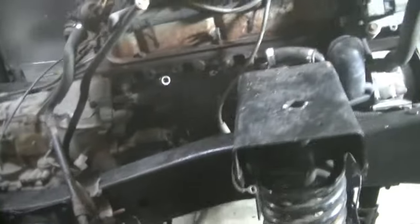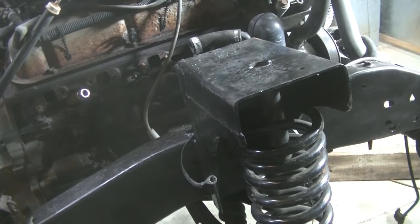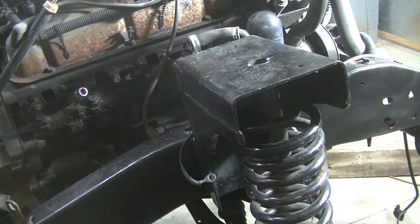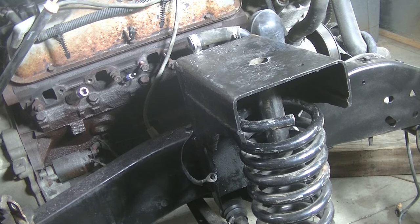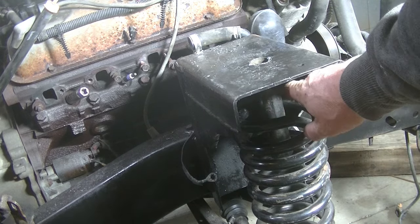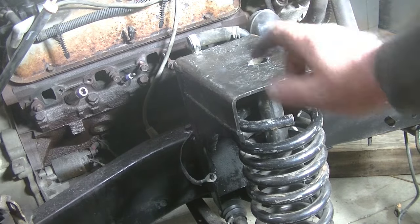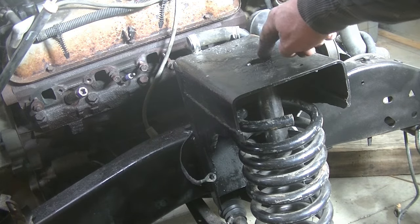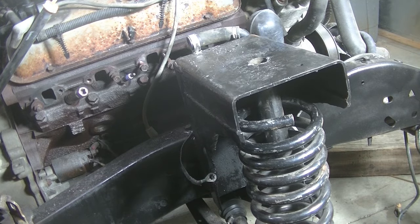While you were away, my camera filled up again — that's why you were away. I just ordered a bigger card. What matters is what we're getting done here. If you can see the pipe inside of here — what I did is when I drilled that hole, I went over to my new grinder and ground the end of the pipe so it's coming up to the top of the spring tower right there. I've got it tacked in right now, but I'm fixing to weld it all the way in.